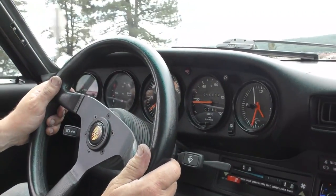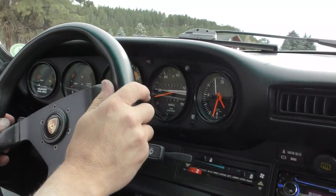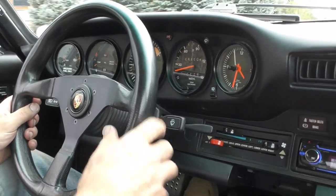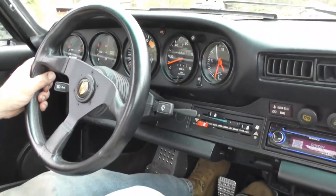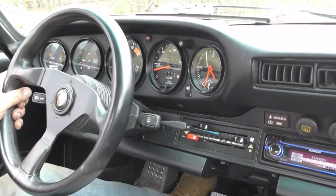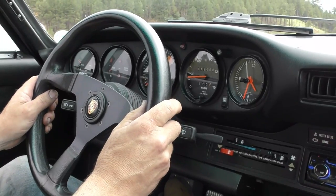The dirt road is in really bad shape until we hit the asphalt, so we're probably not going to see more than second gear for right now. Now, this car before — whenever you were coming back down to first, any movement in the car and you could not select first gear. So I'm just going to do a quick downshift here. Still moving, doing about 10 miles an hour, clutch in, into first — no problems, no grinding, nice and smooth. First, back into second. Feels good, no issues. Just going to get through the dirt here and hit the asphalt.